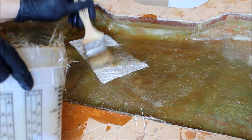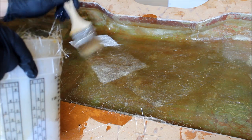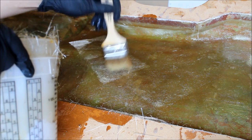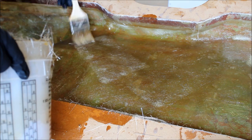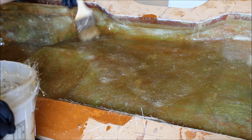So this is basically what we did in the truck. Of course, we taped it and had a mold release agent, so it popped out nicely. And then we spend a little bit of time here working our way thoroughly around the enclosure, making sure we layer it up nicely so it's got a lot of strength to it. Because the stiffer this is and relatively more dense it is, it's just going to be a better sounding enclosure.